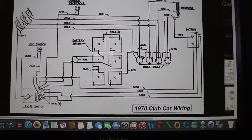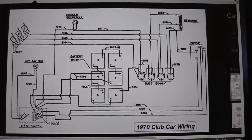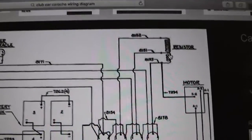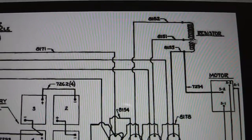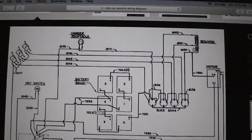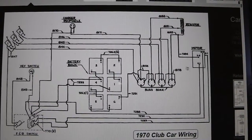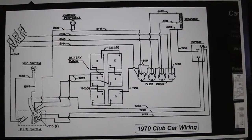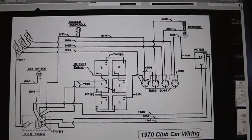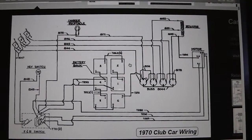I got on the computer and started looking around. If you look here, we have three wires coming off of that coil. I remembered when I stretched it out and thought it just needed one here and one there — well, that's the part that broke. It fried that wire off, and on that burnt plate, that's where that wire went. I eliminated that and put that third wire in the wrong spot — I think I looped it back to the battery. That's why we're getting heat. So I've got that part on order — it's going to be a hundred bucks, which is ridiculous because it's just a bunch of wrapped coils. I already ordered it though.